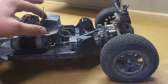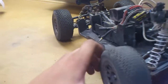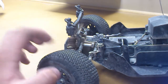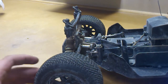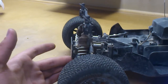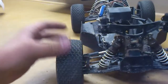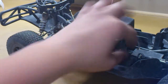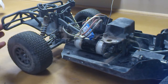The only bad thing about this that I've found so far is you go through tires very quickly. As you can see, this one tire in the back is just bald. These ones are doing a little bit better just because they were on the rear and I'm moving them to the front. Because the front diff spins so much when you initially hit throttle, it lifts up the front just a little bit, makes it really light, and you're just grinding tread off your tires. I'm looking to put a lot thicker differential oil in it just to try and combat some of that. I haven't been able to buy diff oil locally so I have to order some in.